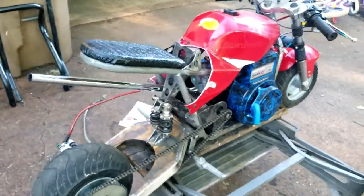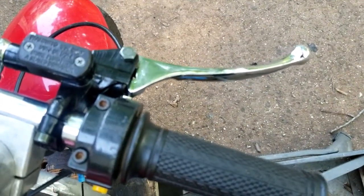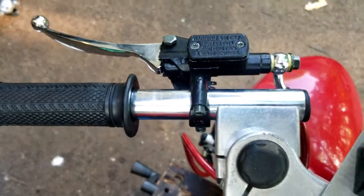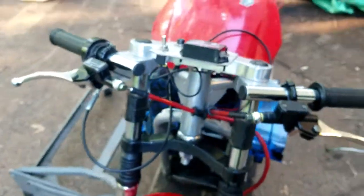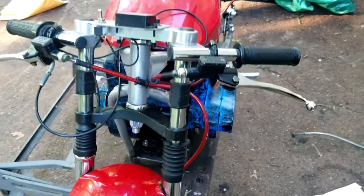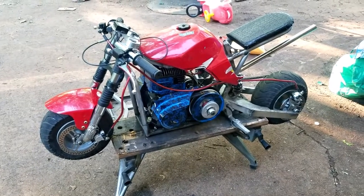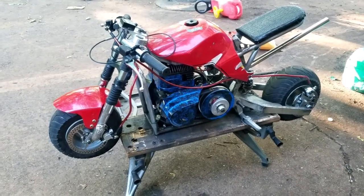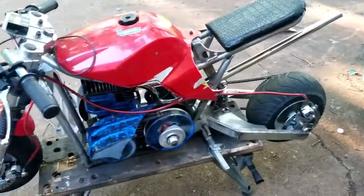Here's how the handles look — there's your master cylinder right here, these are the fronts, and the rear is identical. One thing I also did was flush all the brake fluid out of the master cylinders and put my own DOT 4 fluid in. The sludge that was in there — I don't even know if it was brake fluid to be honest. I'd recommend doing a reflush and putting some good DOT 4 in there.